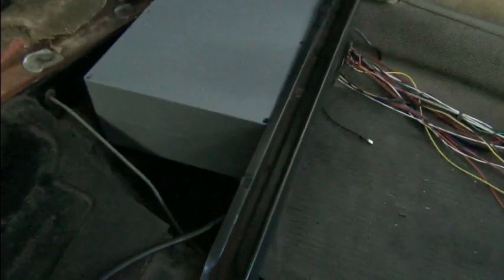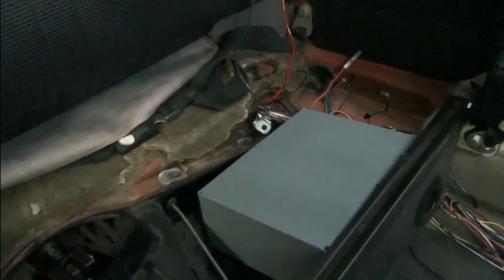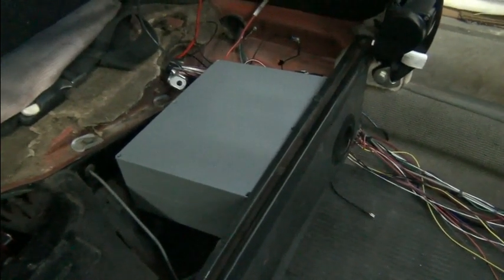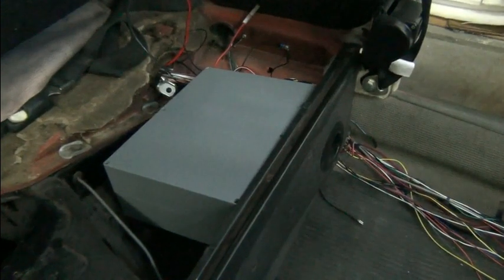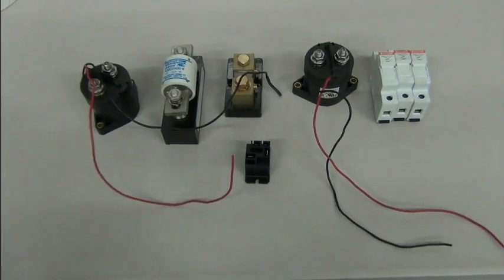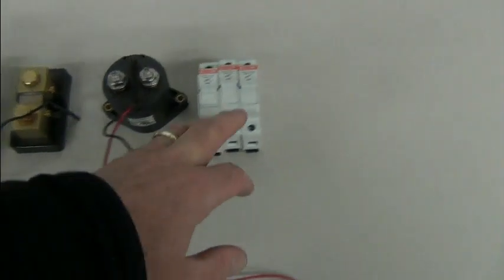We're kind of back to where we started. The seat sits right here in this area and I just don't like this box — I don't know if it was part of the kit or owner-supplied. They had it set up so all the components were going to go right there. What was going to go in that box: two contactors, the shunt, a KSI relay, and three fuses.